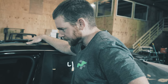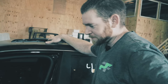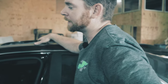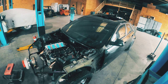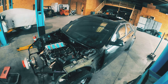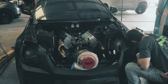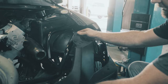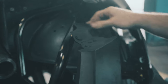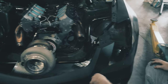So we got to do some wiring — finish up the wiring, rip out some old stuff, put some new stuff in. Put the dash back in. Get the motor back together. Got the front tube work done, turbo mounted back where it needs to be, both fenders back on, got a new driver fender, a new hood going on, new bumper. Mocking this thing back up — need to get it back to where it's going to sit so we can make tabs for the top tubular bars. Then test fit the hood so we can put our hood pin tabs on the top bars.